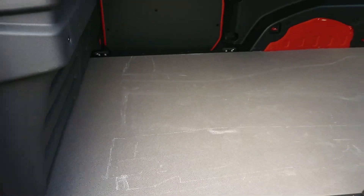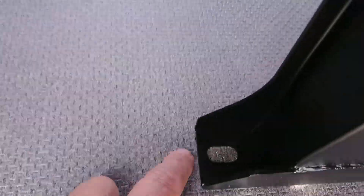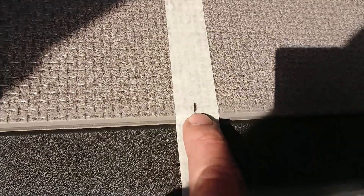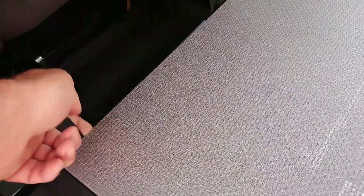So what we've done here: that seat leg is where we're guessing the rear mount is going to be, between the two seat posts. The front mount we're looking for is going to be there — that's a reference mark. This is a reference point. It's 600mm from the front of the board. We've had to remove the bulkhead so we can get a true measurement off the edge of the board rather than just roughly somewhere in there. That is 600mm exactly, and we've done it exactly the same on both sides.